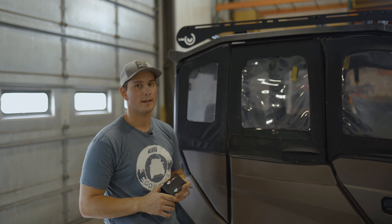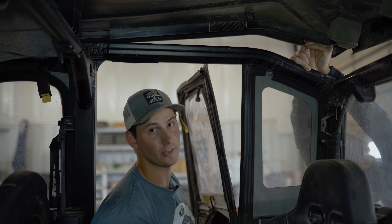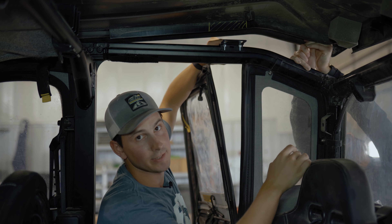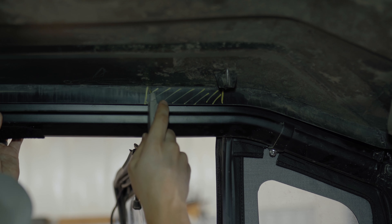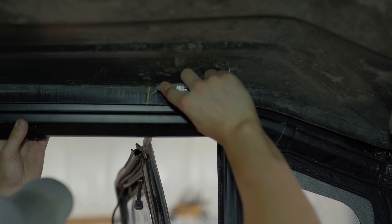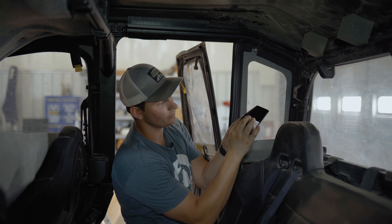Now that our brackets are assembled, we're ready to put them on the back of the vehicle. The bracket needs to sit right underneath that bottom mounting foot. In order for it to sit properly, we're going to have to do some trimming on the inside. Put the bracket in and line it up with the mounting foot on the back, then mark off the area that you're going to cut out. Be sure to give yourself about an inch on either side in case you need to make any adjustments. When you install the bracket, hold it by the bolt so the nut doesn't fall out, then reach up and put it where you need it.